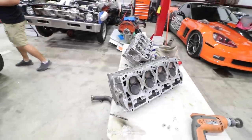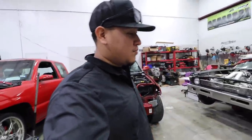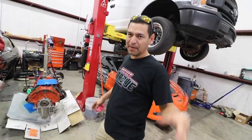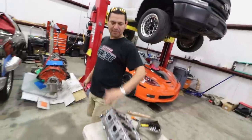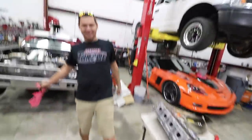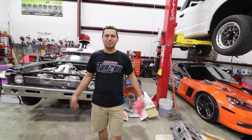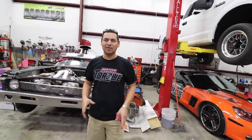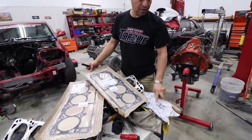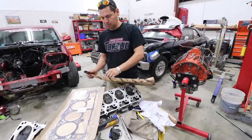Look at the heads — all this looks very good. We're going to make it work. It's the engine for the racing build — different seals, gaskets, everything. 6.1. The headers are about 6 years old and they're rough, but there's no time right now. After the event, we'll fabricate a new set. If they end up having back pressure issues, we'll deal with it then. For now, let's start putting on the heads. Here are the gaskets — they're Mopar, the bolts are also Mopar, already torqued to 31 lbs. We're putting the original ARPs back on.